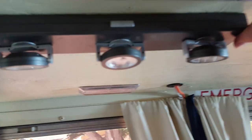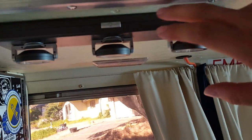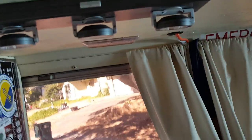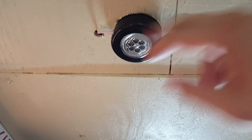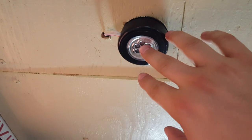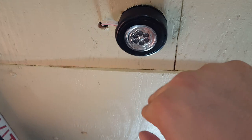There is a small light — it's not working right now because the batteries are dead, but it is completely independent outside of the main battery systems. If you put batteries in this, you'll still have something to turn on and off. One of the cool features I did is underneath the overheads — these little hockey puck-looking guys. They usually use batteries, but I rewired them to run off 12 volts so they run off the battery down below instead of double-A's or triple-A's.